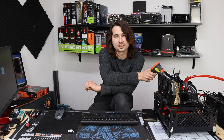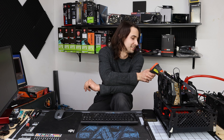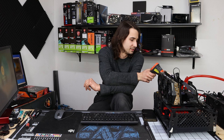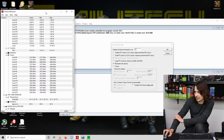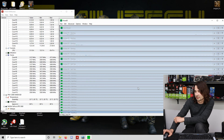Anyone who has overclocked a 3950X will know this is not fun to do. It's tedious because you're working with so many cores that if any single one of them has a problem, the whole thing comes crashing down. With something like six-phase power delivery, it's probably not enough for this. Here's something kind of funny — if you just hit small FFTs on a 3950X with Precision Boost Overdrive on and hit OK, it's probably just going to turn off. Yeah, it just crashes. It gets so hot so fast that it literally will just crash.